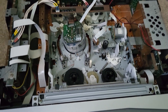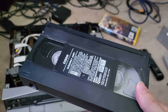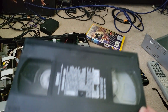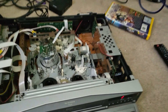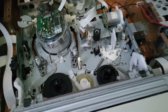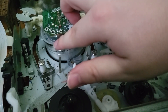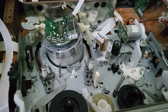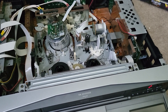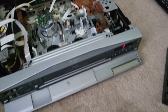If you don't know anything about these, this is still a VHS mechanism. This tape — Runaway Jury — is one of the harder to find tapes, and funny enough it was the first film I watched on the format, so I felt it would be a good one for testing. Here's the head drum — there are loads of video heads on there. Not all of them are used for D-Theater playback; you still have the heads for VHS playback, including the Hi-Fi heads, so those are still present and you can still play a VHS tape on here.